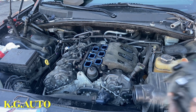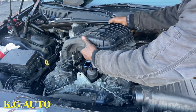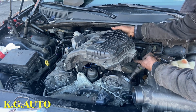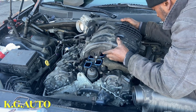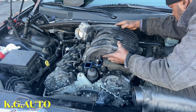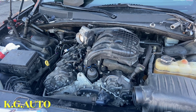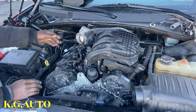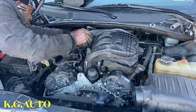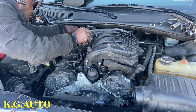But you wanna make sure, you see this guy? The trick of putting this guy in. See, got these two slots here. So make sure that two slot goes in here before you rest it down. If not, it won't go all the way in. Go through that slot first. There we go. So once you go through that slot, you can bring it down now. Make sure that nothing is holding it to the wheel, like some holes or little stuff. See, just like this guy.